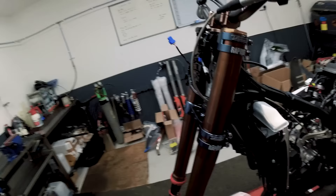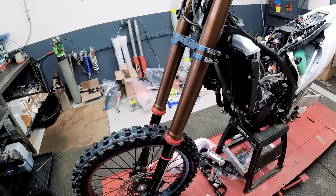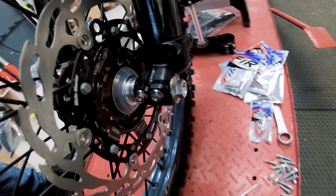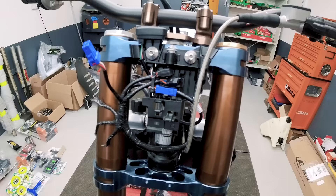Battery died on the camera so I cracked on with a little bit. I've got the triple clamps in, got the bars on, front wheel — the forks have all been coated by K-Tech. So it's taken shape slowly. Put the tie bolts in the axle and factory image front wheel nut, tie bolts in the bottom mounts.